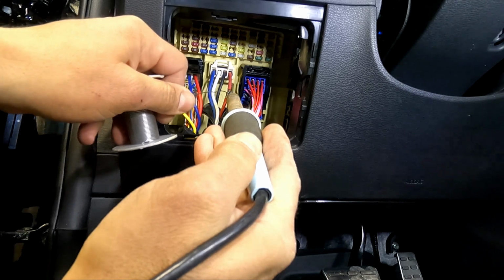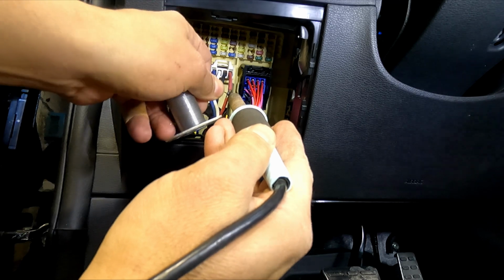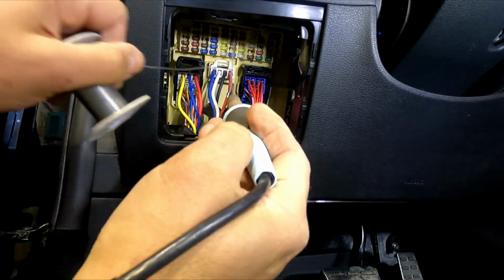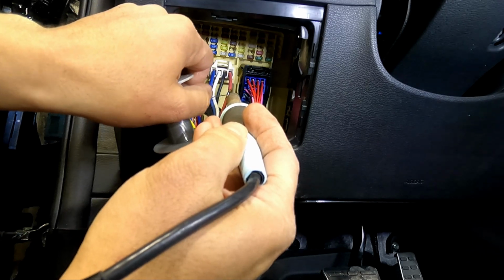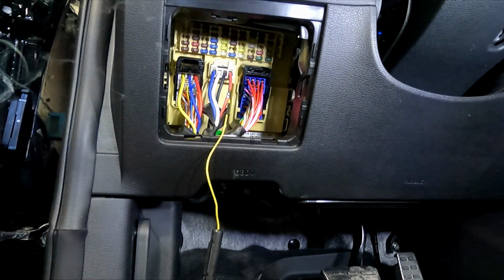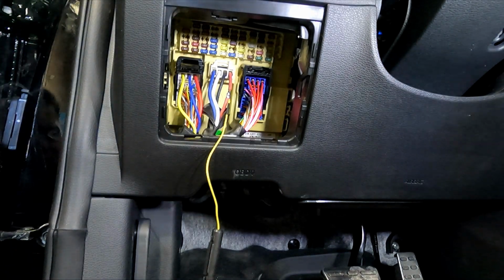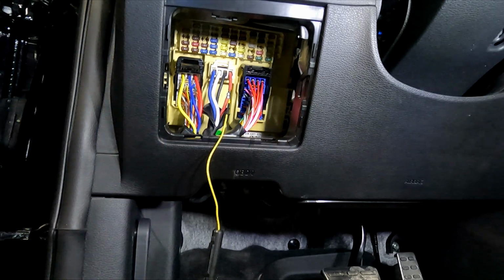Now I'm using a 100-watt soldering system just to make sure it's hot enough. Thick wires will be much easier using those big solders, 100 watt. If you're using a 25 watt, you might find yourself doing what we call cold solder. Okay.